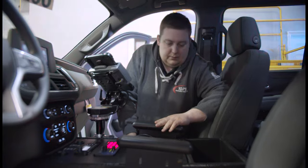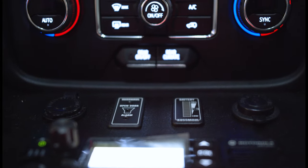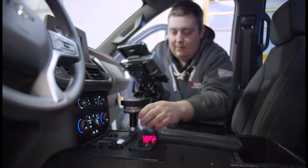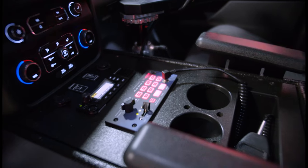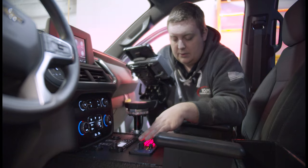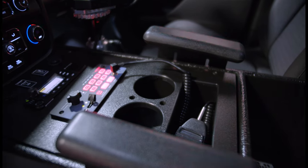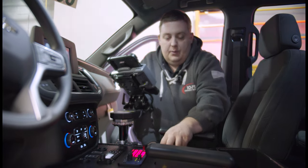One of our custom wood consoles with our HDPE faceplate. We've got outlets for 12 volt and USB. We have a door open alarm to let them know that they may have one of the compartment doors open if the vehicle is in drive, and then we also have the battery indicator to show them the status when the vehicle is charging. Mobile radio cut in. We have our Blueprint controller with our knob — functions for arrow stick, cruise light, low power, amber flashing, and then scene functions for left alley, take down, right alley, and rear scene. Our PA mic, and we've also reprogrammed our radio rebroadcast button to control the low frequency siren installed in it.